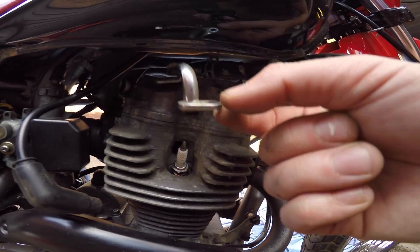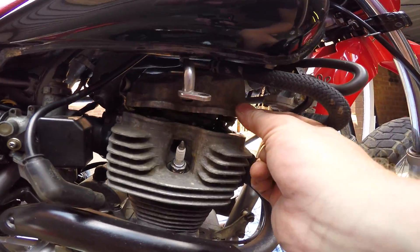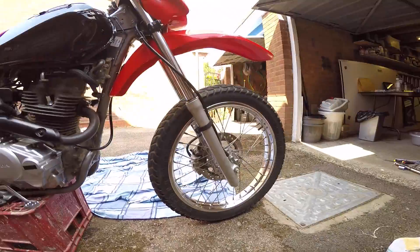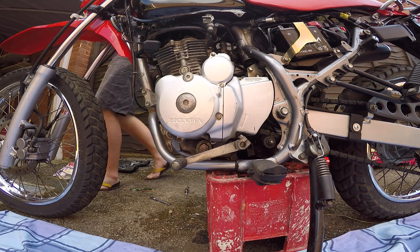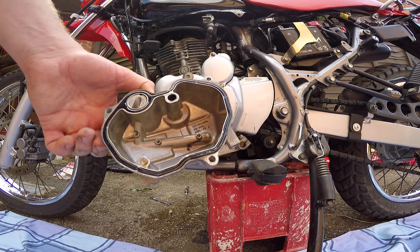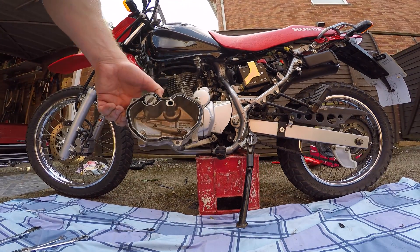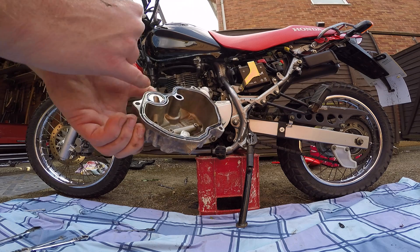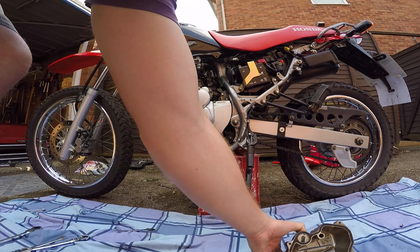There's the other end of this pipe here - it just goes on the top, and then two bolts here which secure the head - and now we'll just lift off. There we go, one rocker cover. There's a gasket in there; I have a replacement and I'll probably put that in, even though it looks quite good. I've just got it clean in there as well.